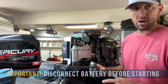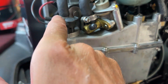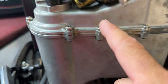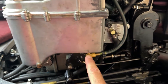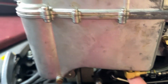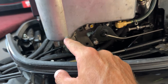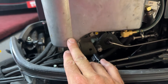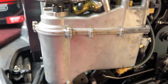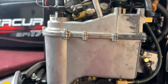Here's what the fuel pump looks like — it sits down in there. Up top it's clamped on, so I'm not going to mess with that. I'm hoping to just unscrew these little hose clamps, pull this off, and disconnect there. I'll need to pull the fuel line off here, and this is the oil transfer line — there are two of those. There's a bolt there, a bolt down here, and one right through there — that should be all I need to remove.